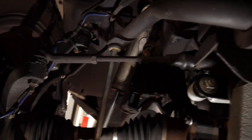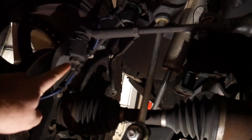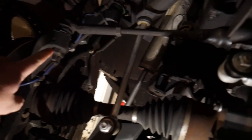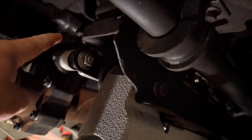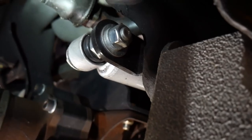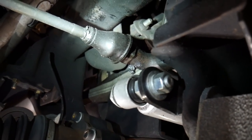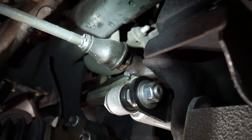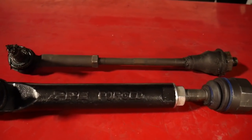We're going to leave the big tires on and get these tie rod ends pulled off. All we have to do is take off this big 19-millimeter nut and then pop it off the spindle. Then the big nut on the inner tie rod end will spin off the inner tie rod sleeve that goes across to the other side. All in all, pretty easy. So we got our old tie rod end off — this is the factory one.